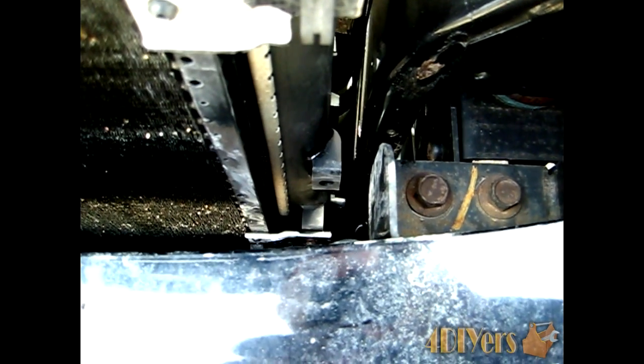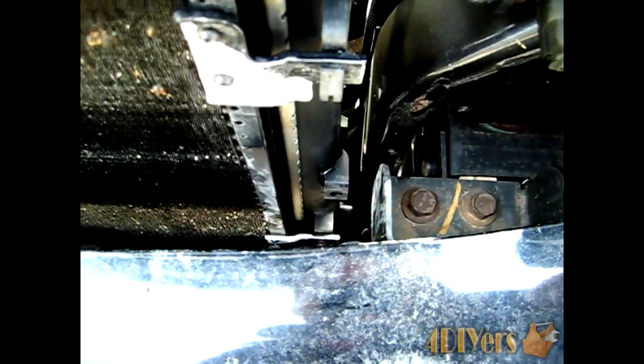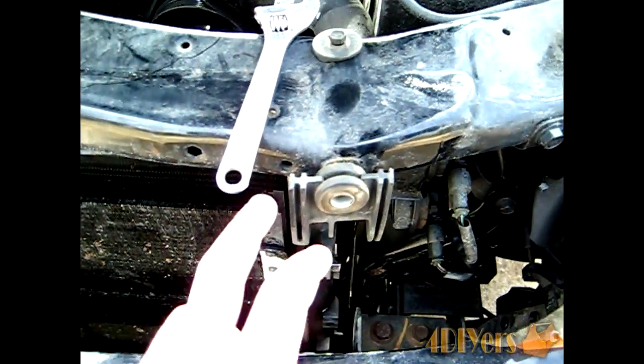What I did is, in order to get to that plug, what I have here is actually a Stampede Edition Dodge Dakota, so it does actually have the extra ground effects on it, which may cause some problems. I'm not sure if you have any other problems in any other models itself. Just to make it easier, the rad is held in by two 10mm bolts itself on the top here, right on the rad support. So you want to remove those.